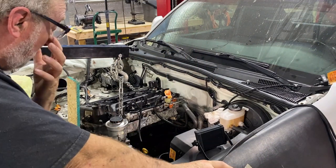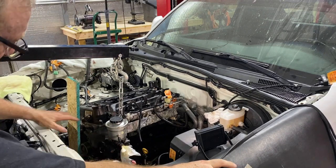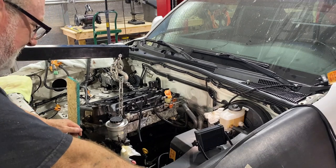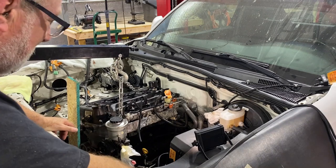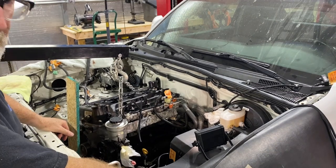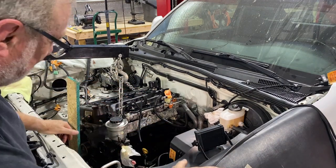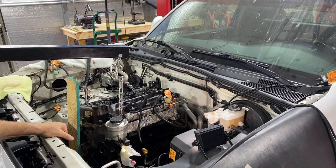I've been working at this for a little while. I put a board here in front of the air conditioning condenser to make sure if the engine let go that it didn't come forward and cause any damage. Separating the engine and transmission is a bit of a job, especially if they have any miles on them. This is a low mileage truck — it is extremely clean, not 4x4, hasn't been off-road. It took me a better part of an hour prying and tugging. I put a transmission jack under it to try to get the angle between the engine and transmission correct, and it finally let go. So I think we can finally pull the engine out now.